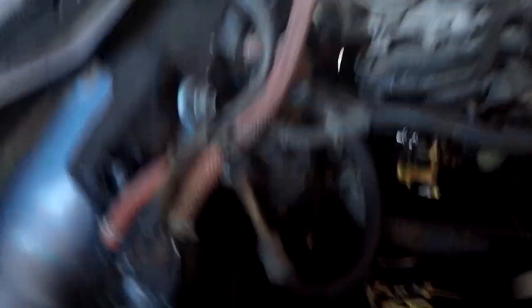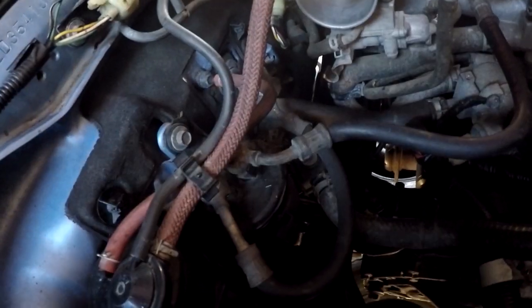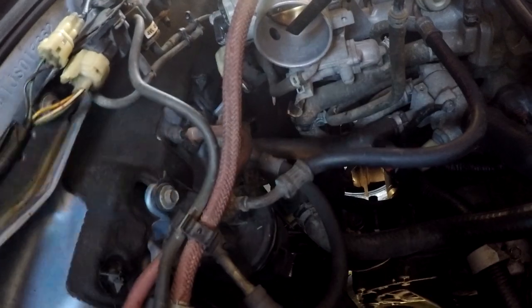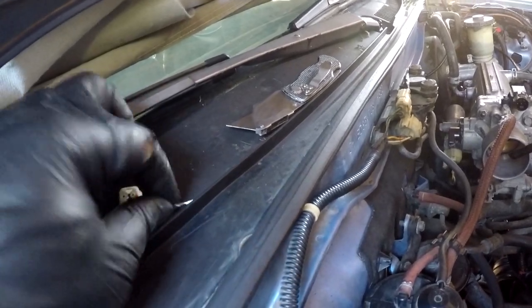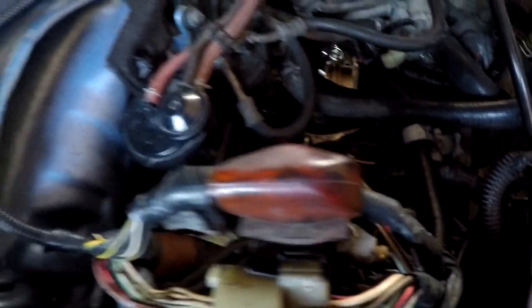The plugs actually fit - it was the exact same terminal that came out of the plug originally. The grommet on the plug from the one already connected to the car was brittle and hard, so I couldn't shove it into the plug. But with a razor blade and a lot of trimming I pretty much got it all in there. Be sure to put back the retaining clip because this is what keeps the clip compressed against the pin itself to keep it from coming out.